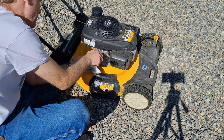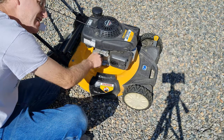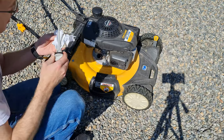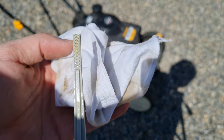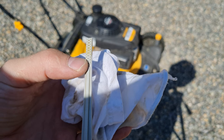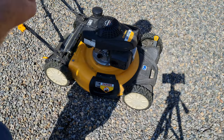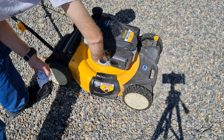I'm going to head back to the oil dipstick — open it up, pull it out, wipe it off, stick it all the way back in, open it up again, and check where the oil marks are. You can hopefully see the oil marks are right there — about three marks below the top, which for me is perfect. I'm going to mow the lawn at least once, recheck the oil, and if need be I'll add some more.